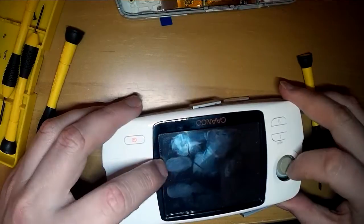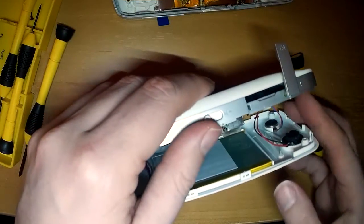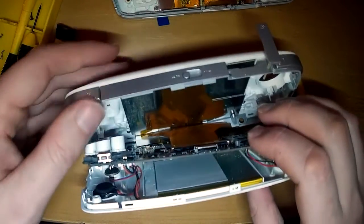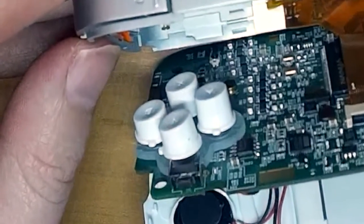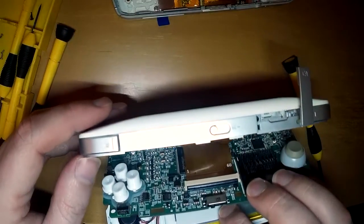The board doesn't pop out as easily as you think — you kind of have to nurse it a little bit, and eventually it unclicks and comes out. Now something very important at this point is the orientation of the buttons X, Y, A and B, because you can see they've got these little notches pointing in a certain direction. You'd think they'd just stick in position but they don't, and that's a big issue when you put it back together.